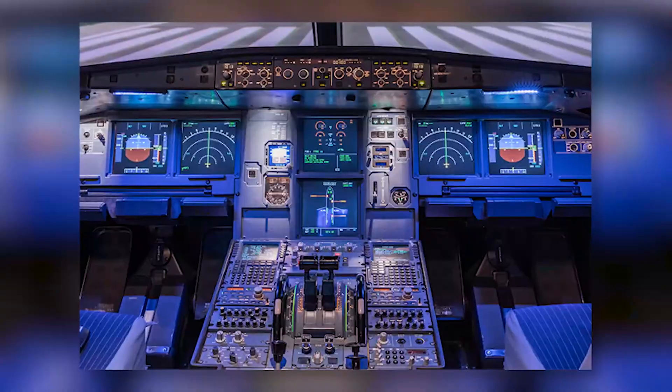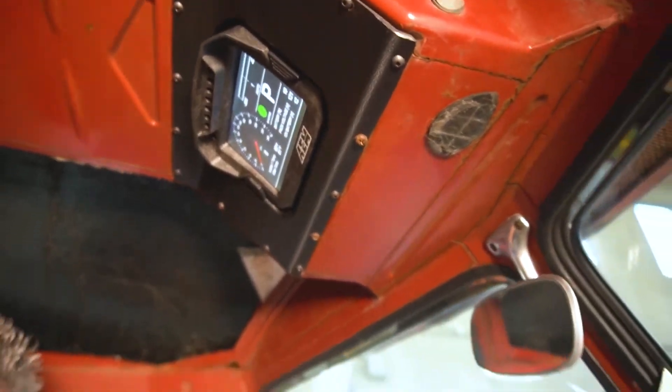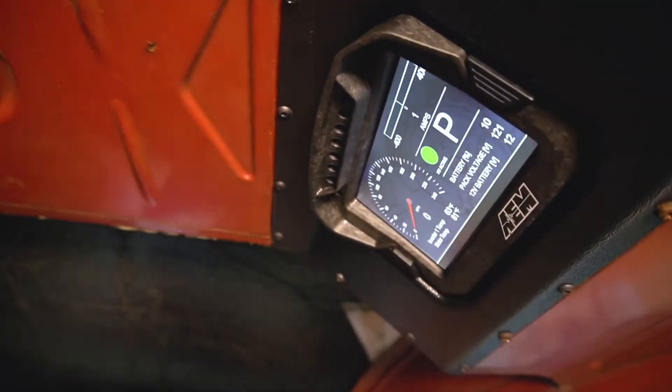One of the last parts is the keypad. Before, this vehicle and a lot of others out there just had some switches or knobs to get in and out of gear and neutral, but it wasn't very descriptive and you didn't get a lot of feedback on what gear you were in. Now we've added our keypad — when you turn the vehicle on with the wake switch there's a high voltage button, so the vehicle comes to life at high voltage and then you select your gear. Combined with that, the CAN keypad feeds to the VCU, the VCU feeds up to the dash, and up in the dash is a big P for park, N for neutral, R for reverse — there's never any guesswork.